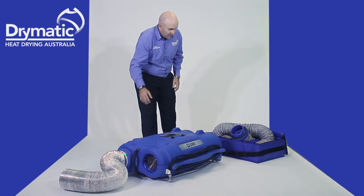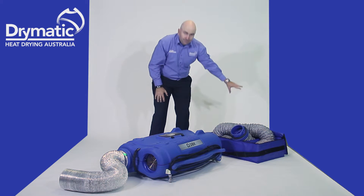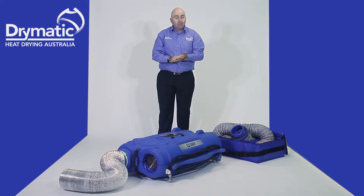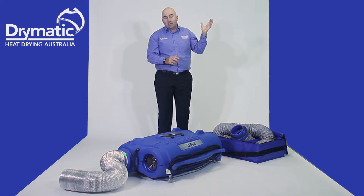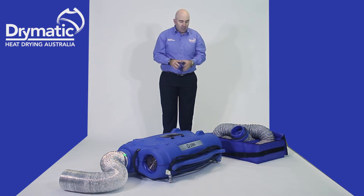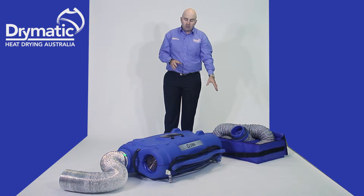In exhaust mode, air comes in one side and out the other. You can place the exhaust out a window, pump wet air into the toilet by putting plastic over the lid and inserting your pipe, pump wet air into the bathroom with an exhaust fan going, or pump wet air into a room that has air conditioning set up. That's where your exhaust output goes.